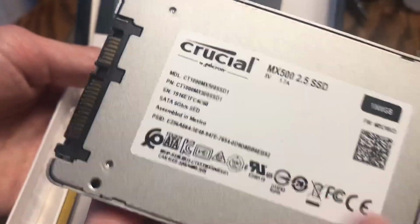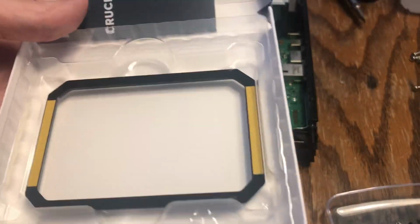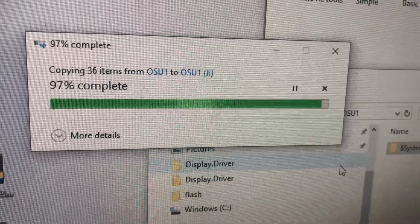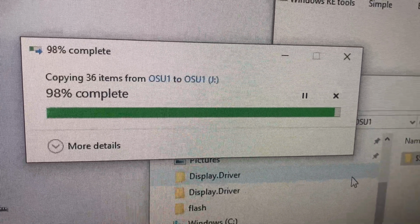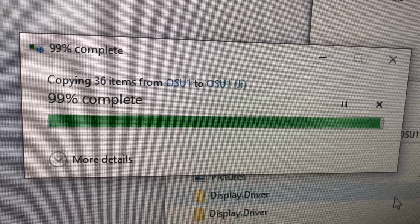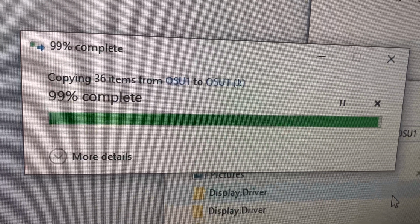In the meantime, I'm just going to go through the process here and repartition this hard drive myself, and then you go run the script, create an offline install USB. All that went smoothly on my computer. Then I went over and powered on the console and ran into a 102 error at first, but then everything went smoothly after that. So I'll keep an eye on things if I have any issues along the way.